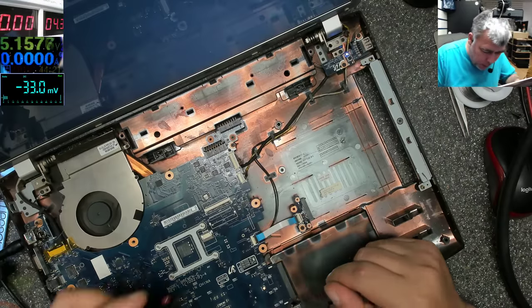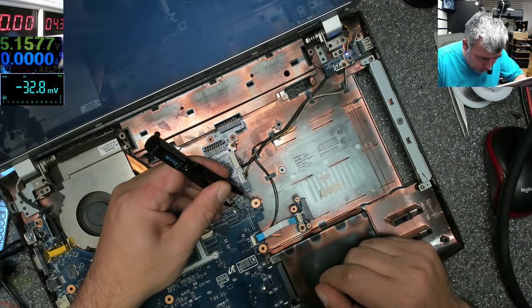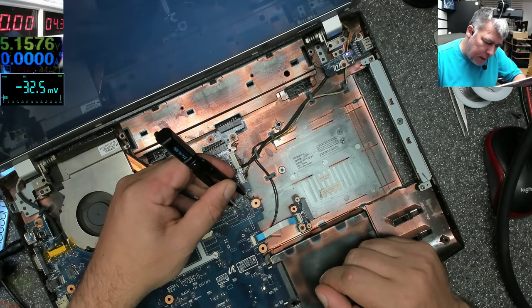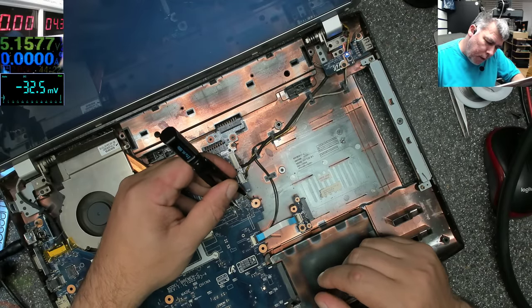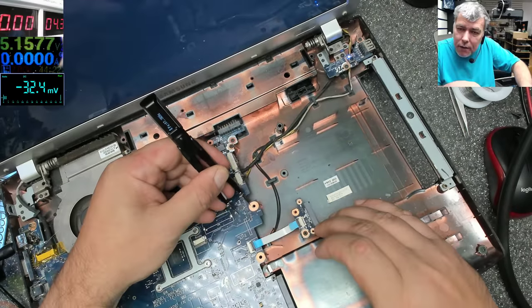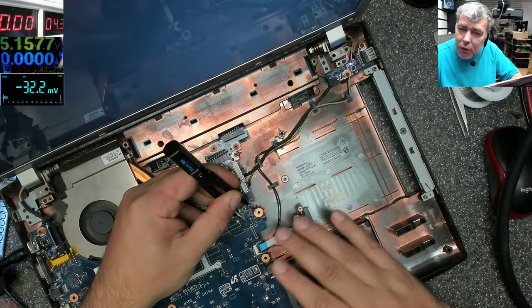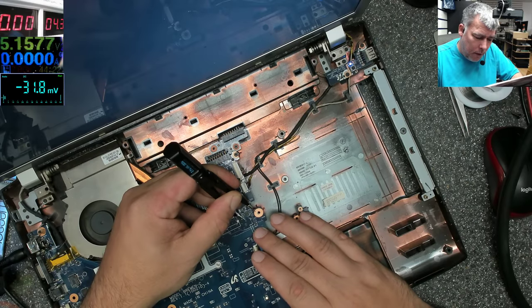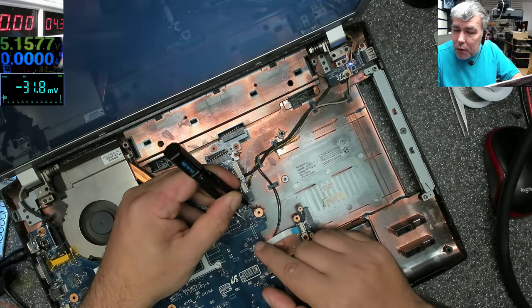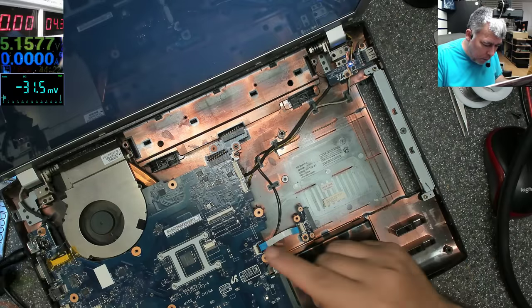If this chip is a power supply, we should have the feedback somewhere. The feedback is exactly the... Okay, probably this is the one. And we have 66 kilohertz. So I'm not sure if this... Usually there are more, yeah? No, on this one, no. 66 kilohertz. Yeah, it can be on the old ones. On the new ones, they work around 200-300 kilohertz, but on the old ones the frequency is lower.